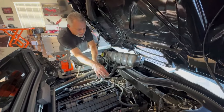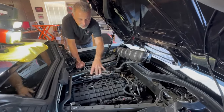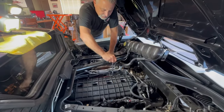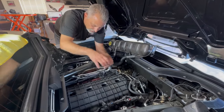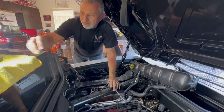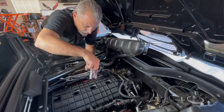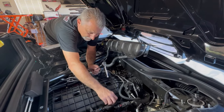Now that we've got this cleared up, we can go ahead and put our cover in place. Normally if this was a coupe, you'd have four bolts — one here, here, here, and right here — but since it's a convertible you just have these two, and you're going to need a couple of extra bolts. These are metric screws with 10 millimeter heads. I happen to have some that match, so it'll look exact. But if you can't find an exact match, take one down to the dealer and see if you can get four with the same thread and the right head.